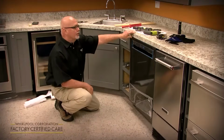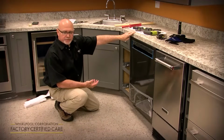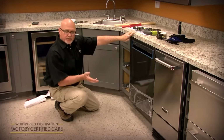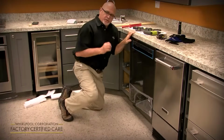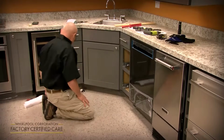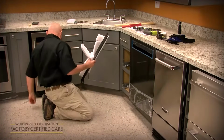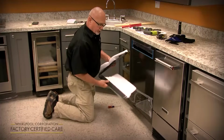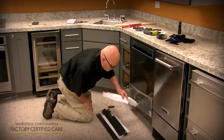And then when you shut the door, it will start to fill up, operate the dispenser. It'll shift through all the spray arms in 30 seconds and then drain out. It's a 5-minute cycle. If you don't have the patience to wait that long, just run a rinse only. While you're putting the toe panel on, you can just watch it, make sure it's not leaking, and then hit cancel drain, and then do the final attachment of the toe and access panel, the insulation.